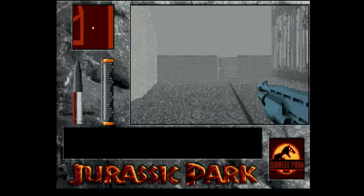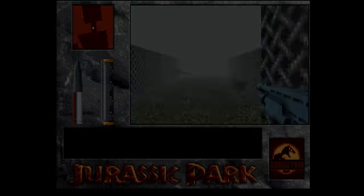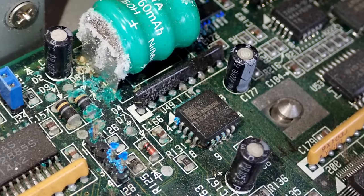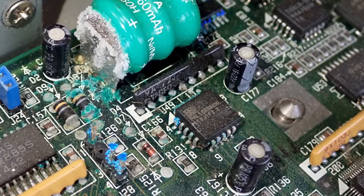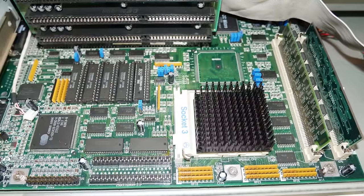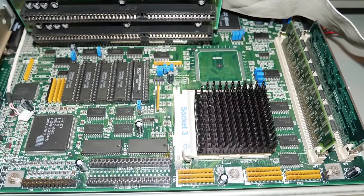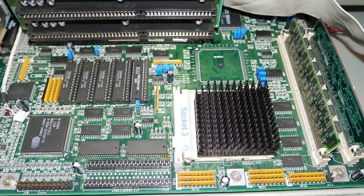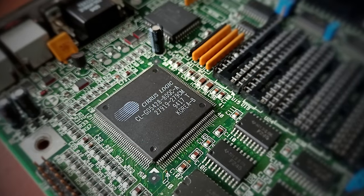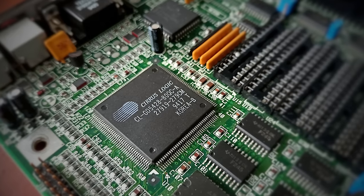This build was a lot of ups and downs. The main board was heavily damaged, but I could restore it. Even the turbo circuitry runs again thanks to reverse engineering of the PAL. Quite a bummer was that level 2 cache spoils the memory throughput on this board and makes it practically useless. On the other hand, with the DX2 CPU and the onboard VLB graphics card, the usual 486 games ran flawlessly.